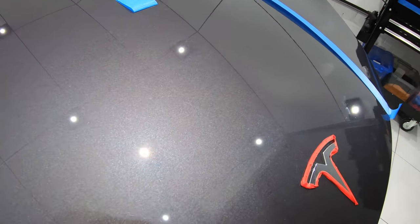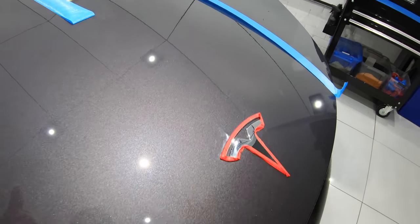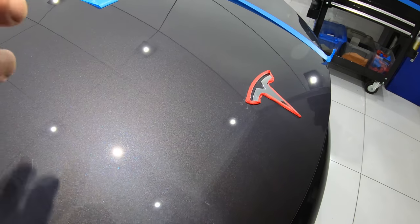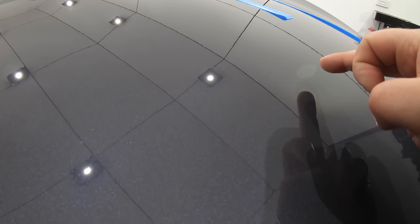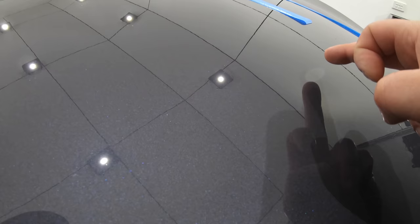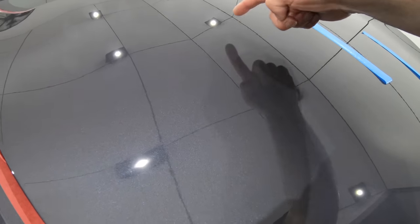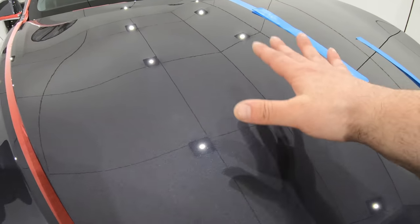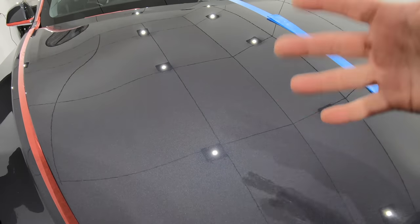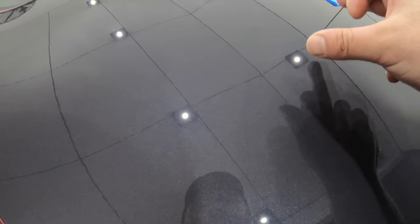Now in truth, if I hadn't measured such inconsistent and low paint thickness readings, I would have further investigated if a slightly more capable medium cutting compound would address even more of the existing defects and bring out even more clarity in the finish. But as it stands, with such low paint thickness readings in certain areas, it's not always about chasing that 100% defect removal and gloss. It's also about being respectful to the car and trying to maintain as much clear coat as possible. But in saying that, I still know that the paint will look absolutely amazing by the time I'm done, and much, much better than how it was originally presented to the customer.